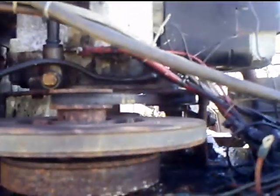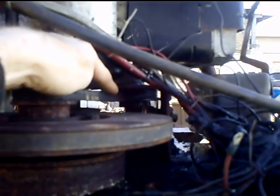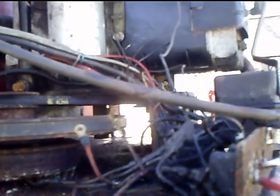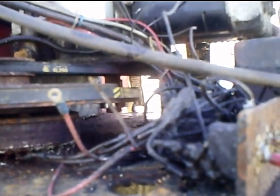Let me back up here a little bit. This belt right here is rubbing on a bolt that mounts the engine, just sitting there rubbing all over it and tearing the shit out of it. And then this pulley and that one — I don't know if you can quite see it, my camera's kind of decked — these two pulleys don't even line up. That's just awesome, isn't it Taz?